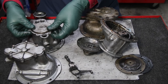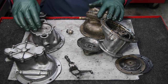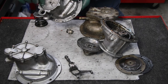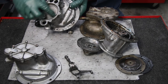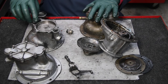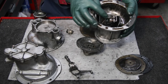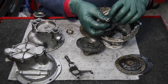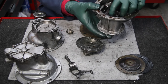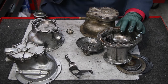Here you can see this one fits in pretty well — that's a pretty good fit. When you take one of these apart, you want to look at it and feel the tight fit on this piston. Also look at the cylinder wall for any excessive scoring — if it's not scored, you've got a pump you can probably put back together. But then you've got the other challenge: where do you get this weird O-ring? I've had a couple of good used O-ring seals and I put those on the website and they sold immediately. On this one, a bolt broke off and may have damaged the thread, so further inspection is needed before I can say it's a good bearing and pump assembly for the 1974 to 1979 models.